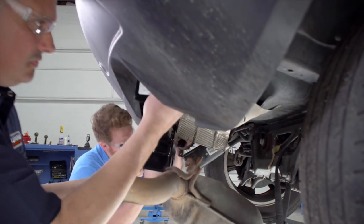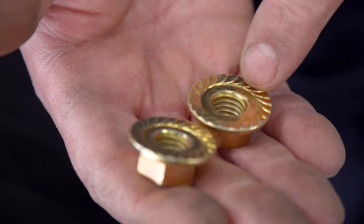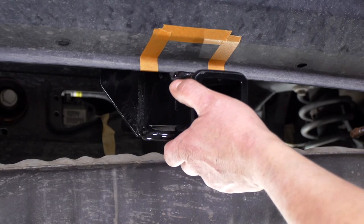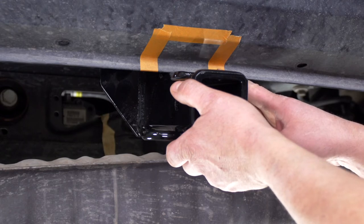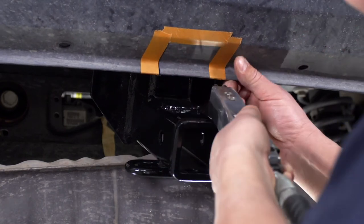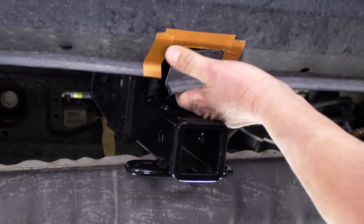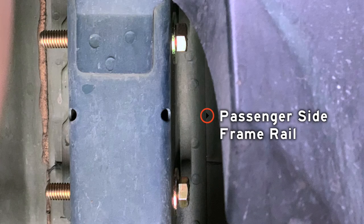Because it's a tight spot, it helps to have a second pair of hands. With our front two bolts in place, we're going to secure them loosely with our flange nuts, installing those with the teeth facing the hitch. We're then able to pivot the hitch upward and mark off the spot, as per the instructions, where we need to cut our bumper fascia — we've marked it off with tape. We're going to make our cut using an air saw. Now that we've made our cut, we lift the hitch up and slide our bolt in the rear most hole; if it goes in, we've cut enough off of the bumper fascia.